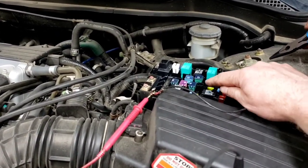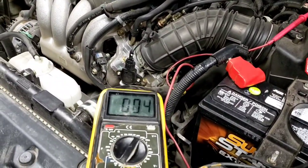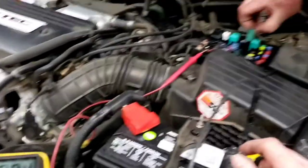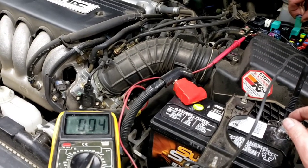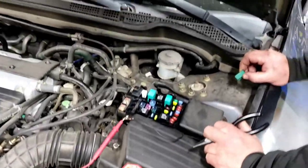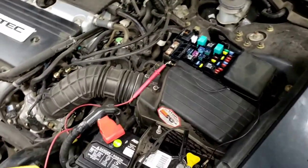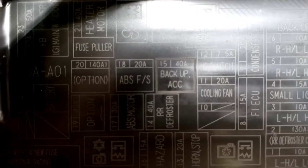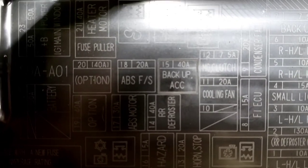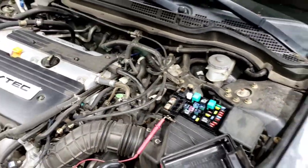He's been going through all the fuses under the hood. Now he pulls the 40-amp fuse — there it changed. Pull it back out — there's our issue right there. That 40-amp fuse is fuse 15: backup accessories. So we're going to look in power distribution to see where this backup accessories fuse goes.